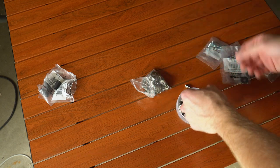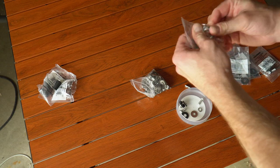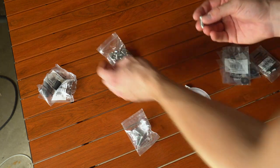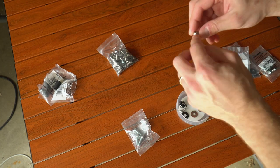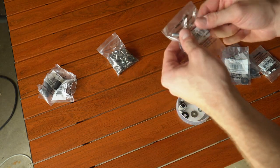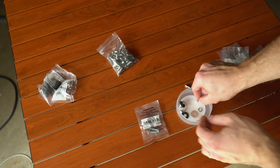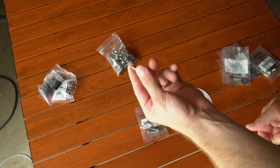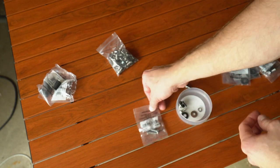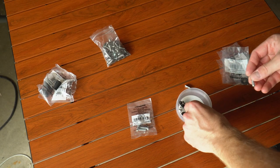For our application the boxes are a little bit thicker, so you have to get the perfect length screw — if you don't get the right size, you're going to have too much play in anchoring it. The size screw I bought is an M6-1x20. I believe the ones that come from Up Top Overland are either 16 or 14, and this is a 20, so it's just slightly longer and I think it's going to work perfectly.